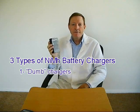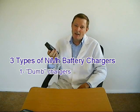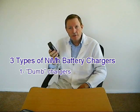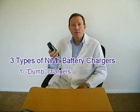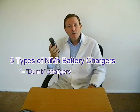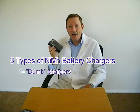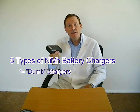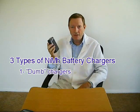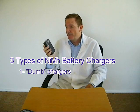For example, if you just leave a full set of batteries in one of these chargers for a week or so during hot weather where room temperature gets above 90 degrees Fahrenheit or so, it is very likely that your batteries will get so hot that they will be damaged or destroyed. In your hot garage or your hot outdoor tool shed, they will damage or destroy your batteries even faster. If you are going to use one of these chargers, you should keep it in an air conditioned room and set a timer to remind you to remove the battery after a few hours. You will want to consult the charger's instructions to determine about how long that would take and interpret that information very, very conservatively. You don't want to burn out your batteries in one of these.